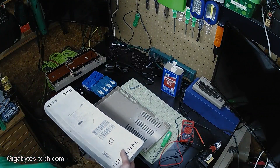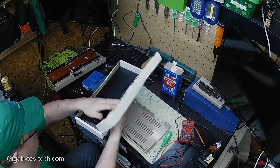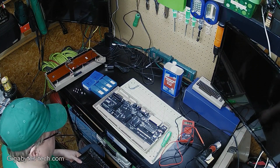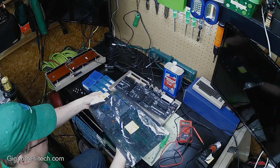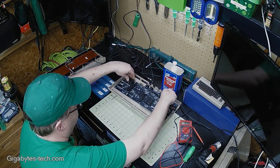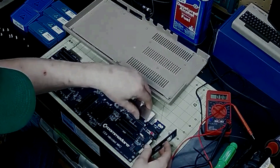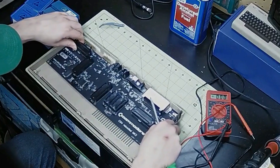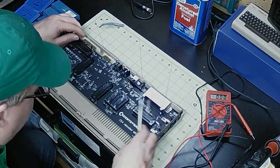That fits like a glove. Let's take a look at the Individual Computers C64 Mark II, Mark II Reloaded. So here it is. One thing I note immediately is that we're probably going to want the panel from the other motherboard. Just have to pull it out a little bit — it's just a couple of screws. Now the holes will line up very nicely here. On a bread bin this old, because this is a shorter board, I am not 100% sure if I'm going to have anything supporting it on the front side.